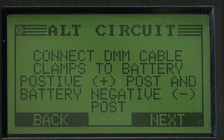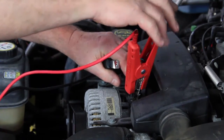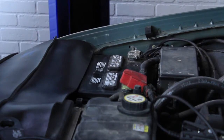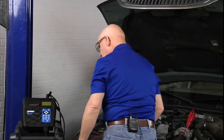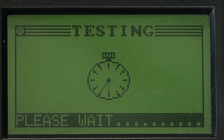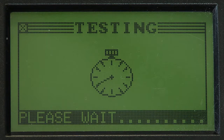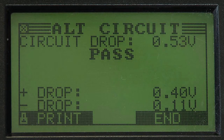The sense leads are going to go with the battery. The connections are real easy. Once I've got that done and hit next, it's going to start the test. This test takes about 20 seconds because it has to verify four components in the circuit — from the positive terminal at the alternator to the positive battery, positive terminal to negative at the battery, and vice versa with the negative side. We can ignore the resistance of the battery itself and just look at the circuit integrity on the negative and positive side. When it's done, we're showing about half a volt of losses — 0.53 volts — for the circuit at 80 amps.